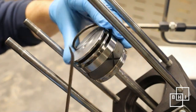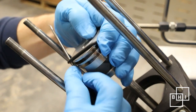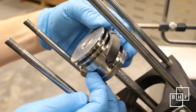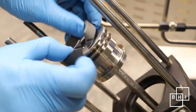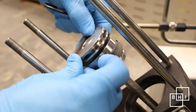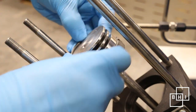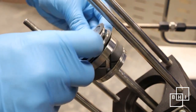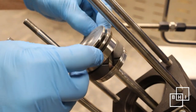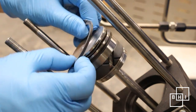The rider ring is split; however, the split is much shorter than that of the compression rings. The rider ring can be easily removed by gently pulling it open until it slides off. To install the rider ring, gently spread the ring and slip it over the end of the piston until it fits into the groove. New backing rings can be similarly installed with a hook. Compression rings are installed in the opposite manner to which they were removed — grab the thin end of the ring, start it into the groove, and gently wind the ring in, trying to minimize bending.